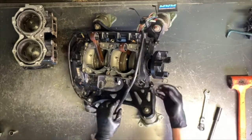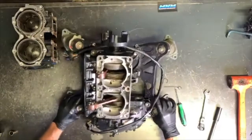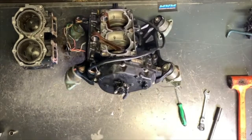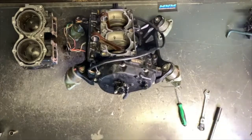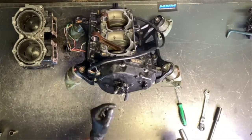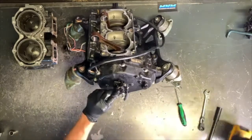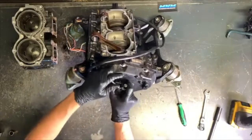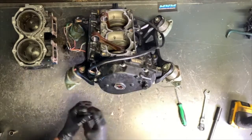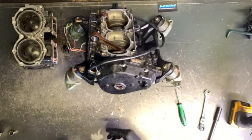We've got our cradle that we could pull off at any point — leaving it on for now. Now we've got our stator — this is what a lot of people ask me to shoot videos on, because you do have to have a special tool to remove it. I'll show you what that special tool is in a bit. We've got 10 millimeter bolts all the way around this cover. We've got our oil pump here — the line was cut. I'm going to remove these two 10 millimeter bolts and lift that oil pump off. Make sure that flat tab slides into that slot when going back together.